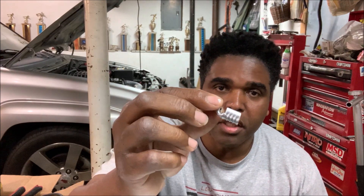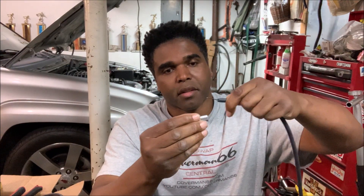Here's the part people don't like: use a little dielectric grease and some silicone in the boot — put some dielectric grease on it and it slides on just like that. Now there are a couple of ways to install these terminals depending on what terminal you have. You can do a dual crimp, where you put the sleeve in and crimp it on the sleeve and then crimp it on the core. We're dealing with a standard crimp.